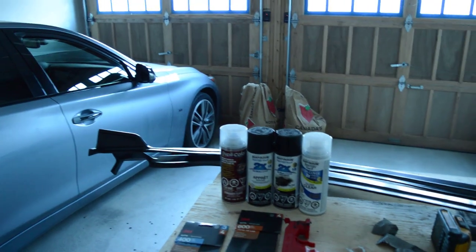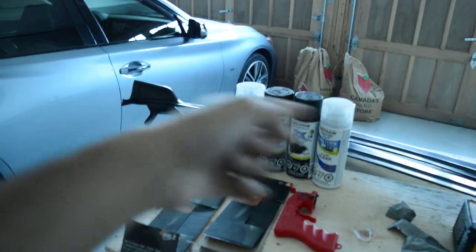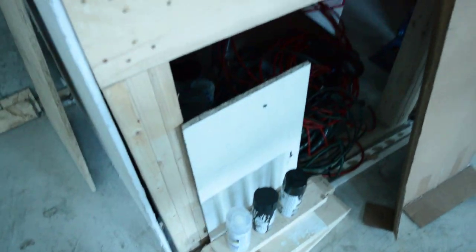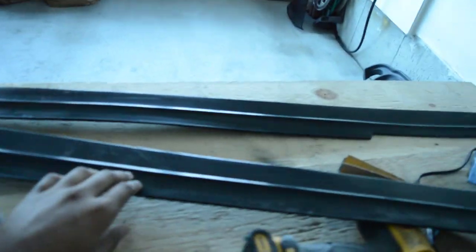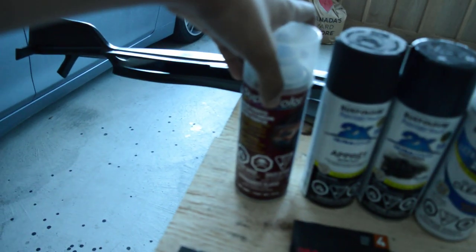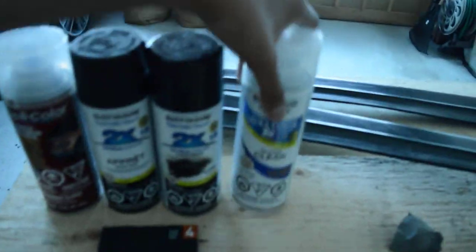I did it myself, it was more fun, and I didn't have to pay anyone. Keep in mind I did get quoted like $800 to get all those things painted. In the description below I will leave how much everything cost me, including all the cans I used and how much sandpaper I needed to buy. Basically the process is: take your 400 grit, sand down the raw polyurethane, then apply your adhesion promoter, then go with your primer, your base coat of your choice, and finish up with your clear coat. That's basically it.